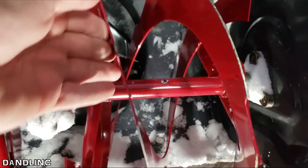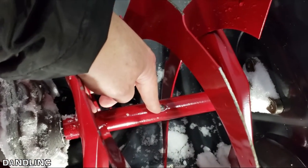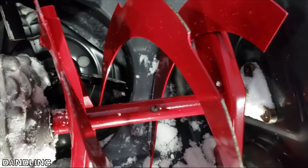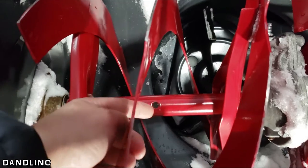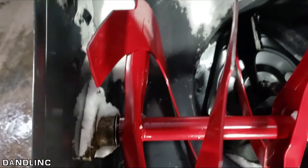I'm going to spin this around — I took the key out. You see that hole right there in the center? That usually has half the shear pin in there, but in my case they both came out, which is kind of nice. If they're stuck in there, just get a punch or a screwdriver and pop it out with a mallet. This one is not lined up with the hole, so I'm going to use a screwdriver and turn this around.